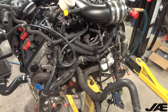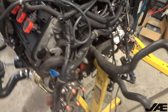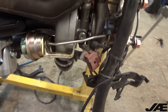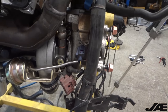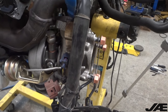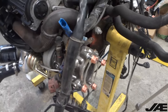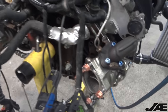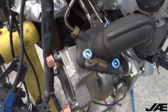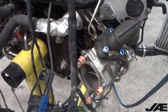In that last clip what I was doing was double checking the wastegate preload - basically just turning up the boost leak tester and holding my finger on the gate to find out exactly when it cracks, which is about 5 or 6 psi on these OEM KO4s, and then when it's fully opened which ended up being around 10 or 11 psi. They're both set evenly so we can be sure we're going to have steady boost.